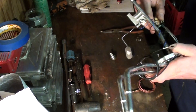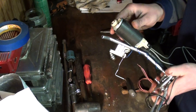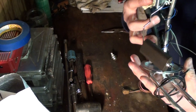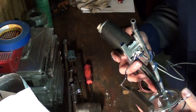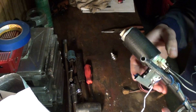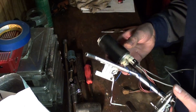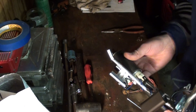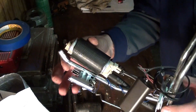That should fit right on — like a glove. Basically, the idea is I'm going to use the return side as the feed. The Walbro 255 I bought and used on the Grand National sender — the pump itself to the sender — it's a 5/16" feed, and then it balloons up to a 3/8". Why it does that is beyond me.